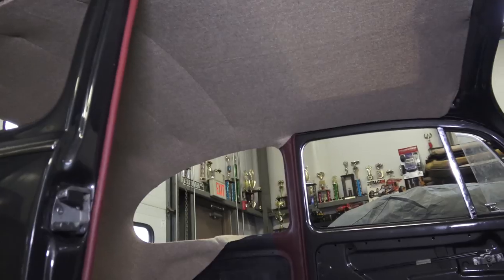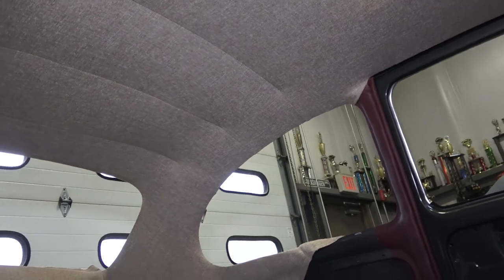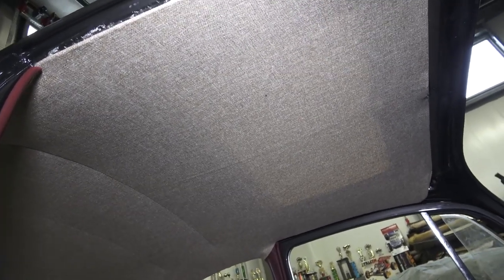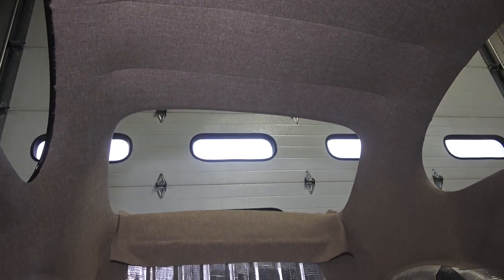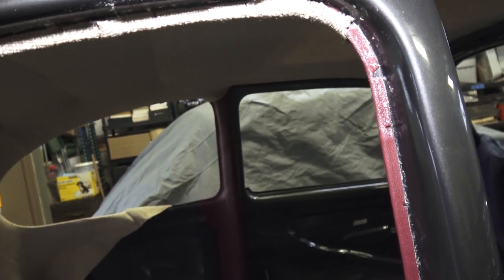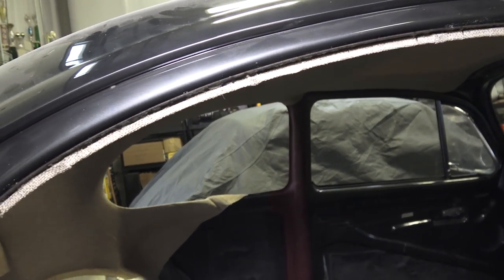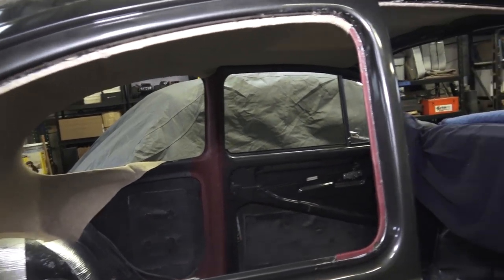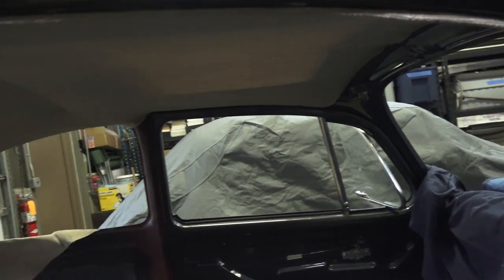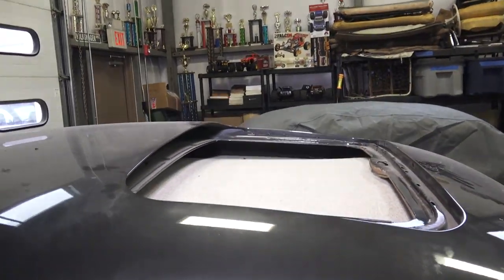There's a nice clean section and we're already up to the quarter windows. We pushed and pulled it tight to the front and it's over the door areas as well with the grippers. We did the door post first, pulled it again to the back — it's a nice uniform look, and of course it passes underneath the sunroof opening. The back of the headliner below the back window we lightly placed down for now. Once we're finished in the window openings, trim everything. This car is going to get pop-out windows, so before you put the headliner in make sure you put your hardware into place at the rear quarter window so you can find those screws. Trim off above the door area as well when you bang up the grippers.